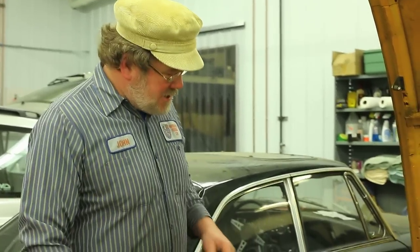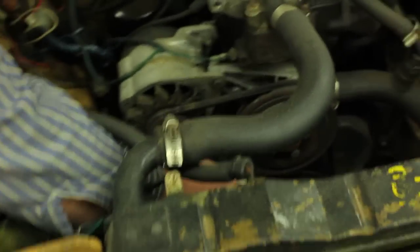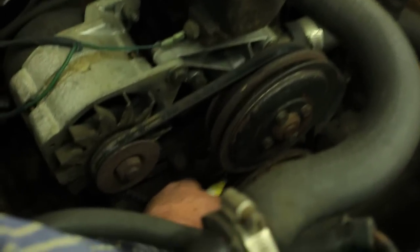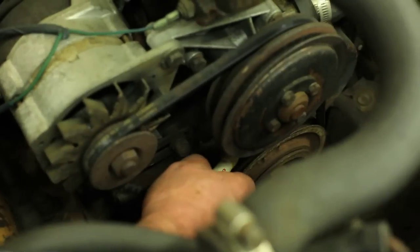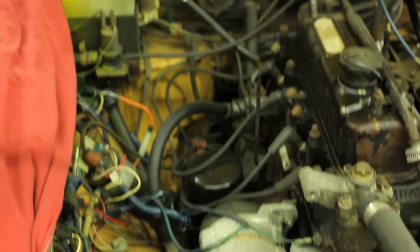I want to show you how we're going to do it on an engine here. We're going to go along pretty quickly, but I'll do all the talking I can to try to make it understandable. First of all, let's get the engine at top dead center. How are we going to do that? We're going to take our paint pencil and make our timing marks here nice and yellow. So there's our timing marks. You can buy the paint pencils at Staples, places like that.